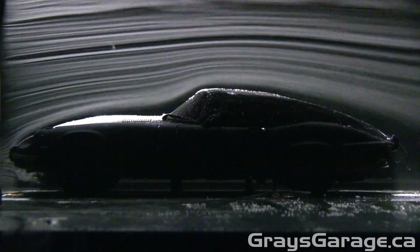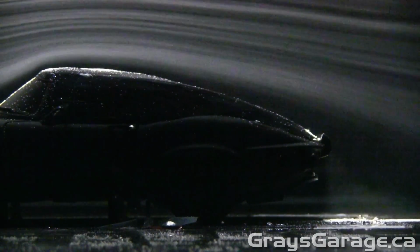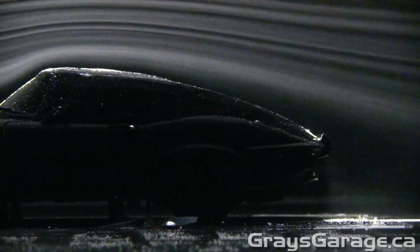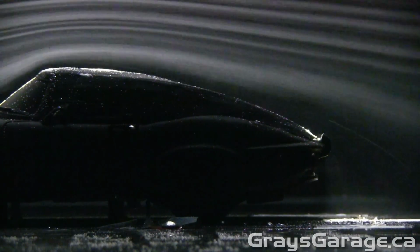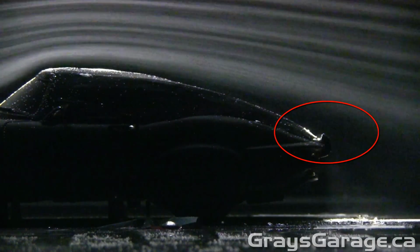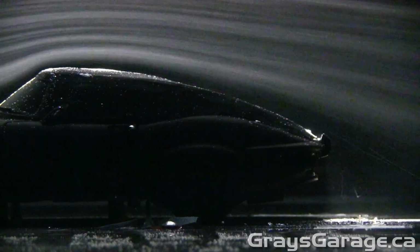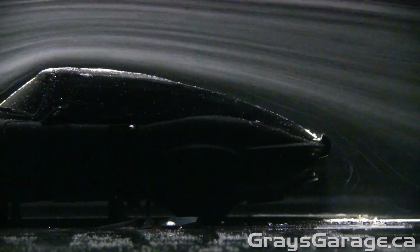Let's now focus in on the back. Here we're zoomed into the back portion of the flow for the hardtop coupe. And as before, we can see how those streamlines are moving smoothly along the back surface. Near the rear bumper, the flow can't follow the lines of the vehicle anymore, and we do get separation with some recirculation at the back near the exhaust outlet. And here we can make that comparison between the two-seater hardtop coupe and the 2+2.